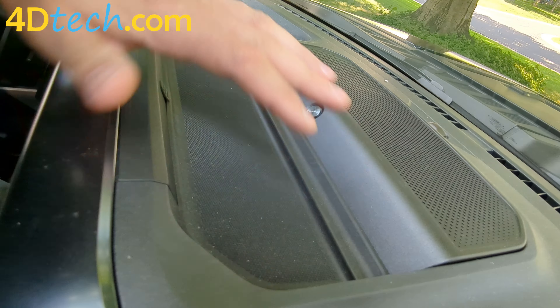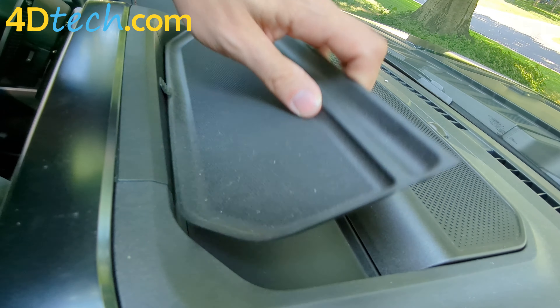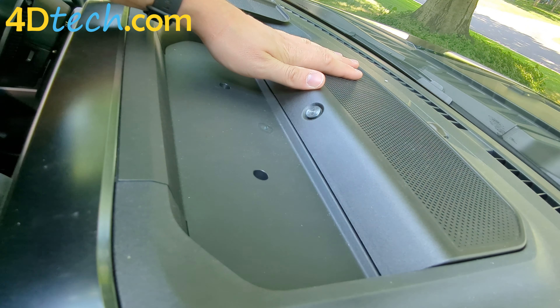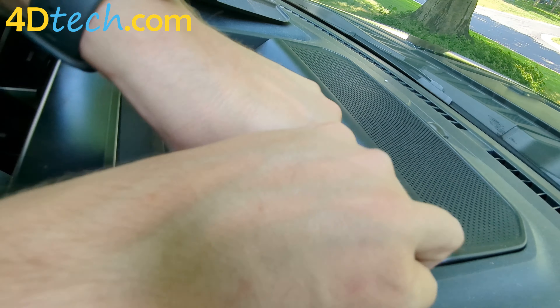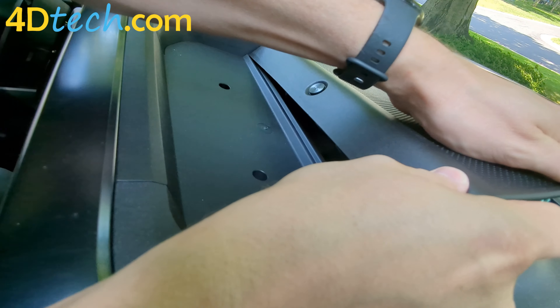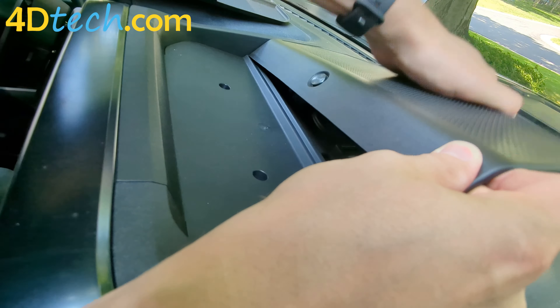Right now we're looking at the pocket area above the screen in the vehicle. We'll remove any rubber mat. It might look a little different if you don't have the B&O center speaker, but the install is still the same. Next, we're going to pop up the speaker grille using a plastic dash removal tool. Just get under the edge, start peeling it up, releasing all the clips as we go. There are eight clips in the back of this.